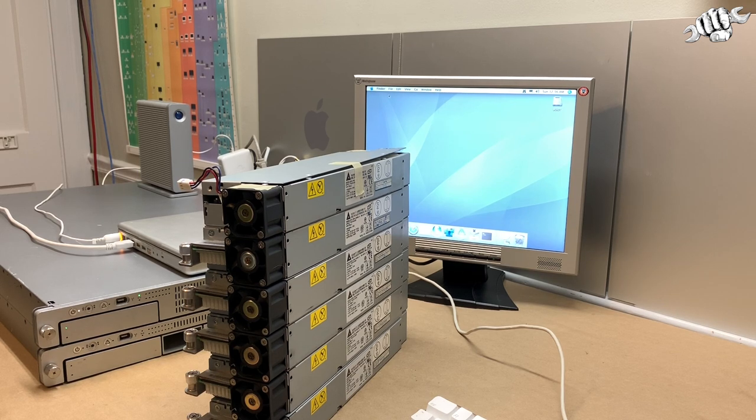But I wanted to do this little intro, and in the next video I will be covering the several ways in which you can install a cluster node Xserve. I had a certain way in mind with the video card and the external FireWire drive, because target disk mode wouldn't work for me. It just refused to work, and I tried that for a few days. Apparently with Tiger it does work. So I will be going over all the ways, and depending on your scenario, the best way to set up a cluster node Xserve for a quick deployment.